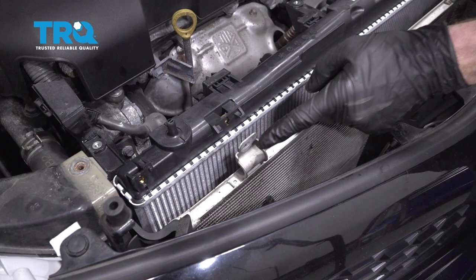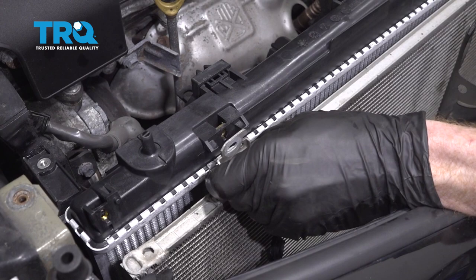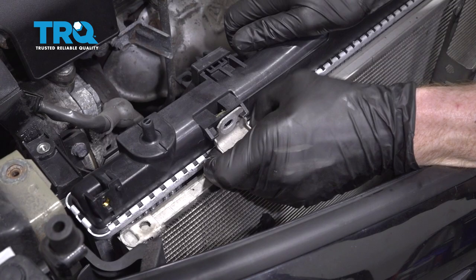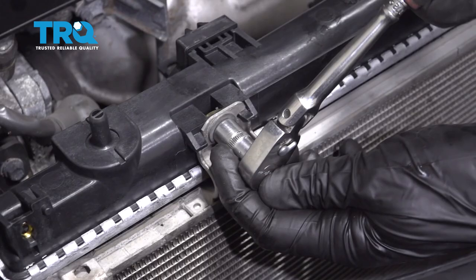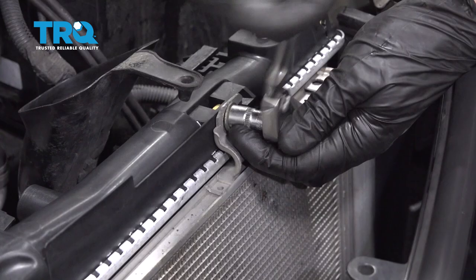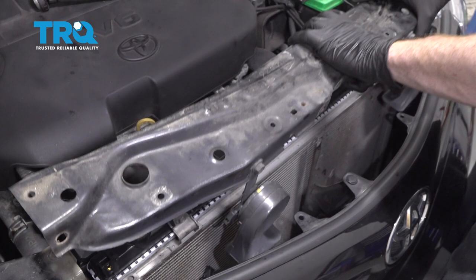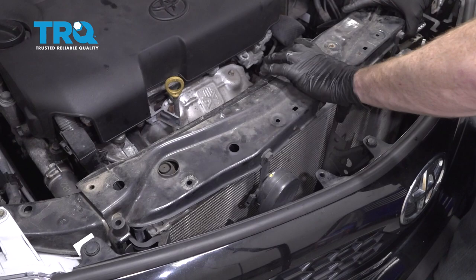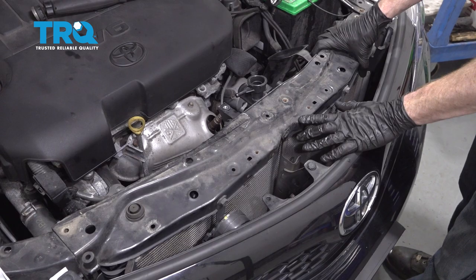Now we're ready to start installing our radiator and fan assembly. Be very careful not to damage any of the fins on your radiator — it should slide straight on down through. Make sure the radiator is sitting down inside those rubber grommets at the bottom. Once your radiator is settled, take our AC condenser — look at the tabs, there's a little cutout marking that needs to line up with that area right there. Carefully bring this up and slide it into position. Start the mounting bolt in there, then do the same to the other side. After we get them both started, we can snug them up. Put these right on top of the radiator pins, carefully put it in here and line up those boots, pull it into position. Once everything's lined up, start in all of your mounting bolts before you snug any of them up, then tighten these up.